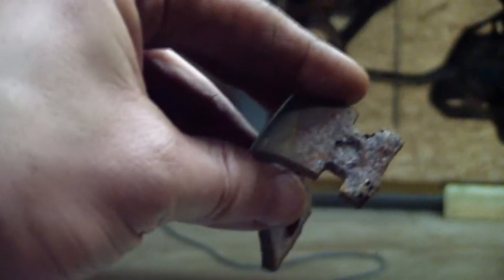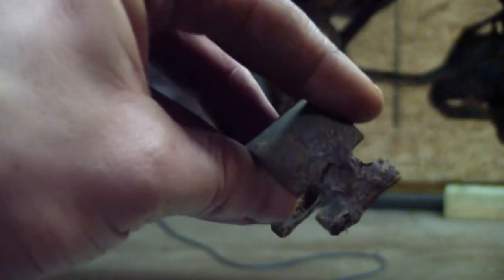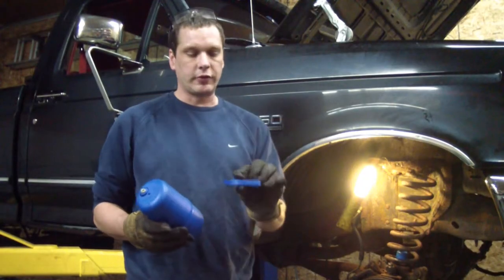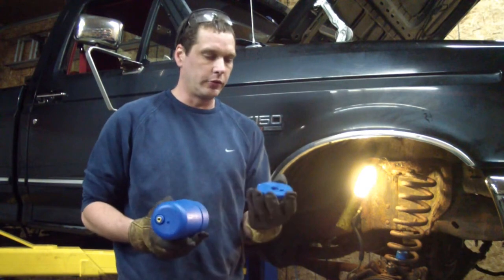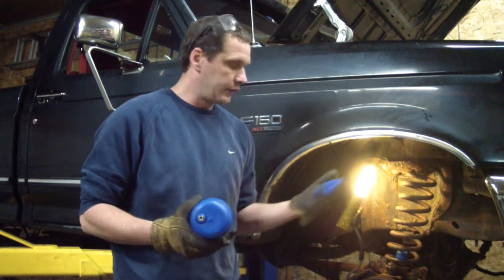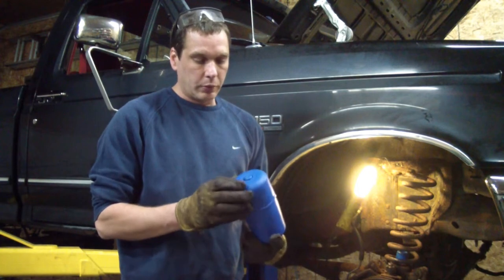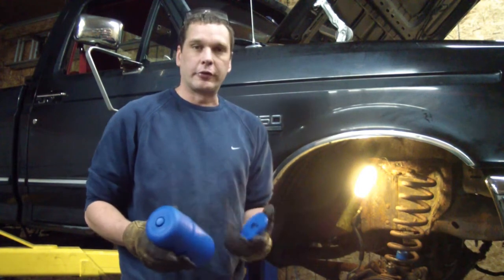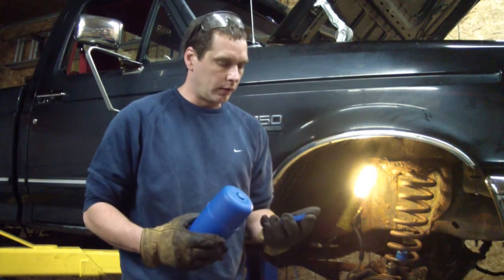Here's a J-clip that holds the top of the spring on. You can see it hooks onto the chassis on this end. The bolt goes through there. So there's the bolt. No matter what, this thing has to go on top of that. So according to the instructions, if the bolt faces the other direction, you would use this. And if it's the way it is, you don't need it. When we inflate this, this tab actually comes with the bottom of this airbag. I'm going to leave the spacer in anyway, though, because these springs are pretty tall.